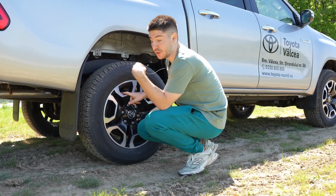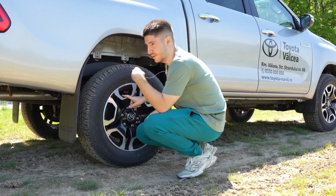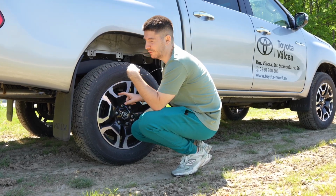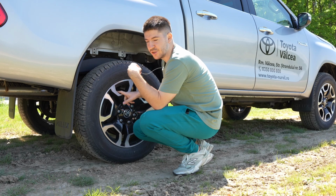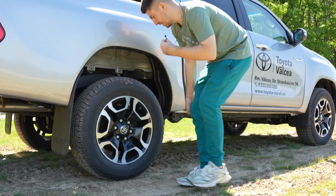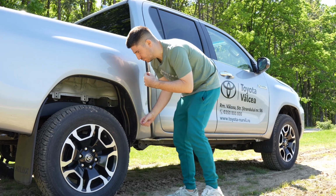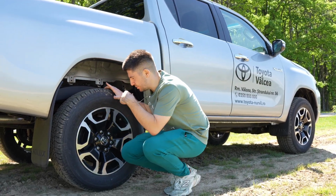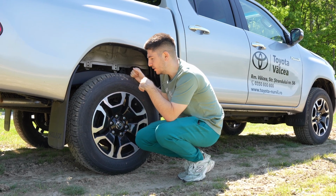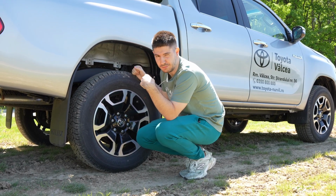they become inefficient. But if you have a vehicle which does not go very fast and you don't have that much heating, it's much more efficient to use brake drums. That's why you see brake drums in vehicles like this or in vehicles which do not have that much power. Plus, having a brake drum like this will require little to no maintenance long term.